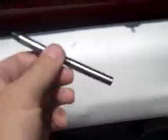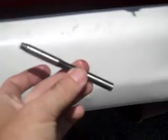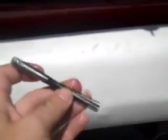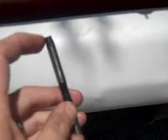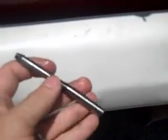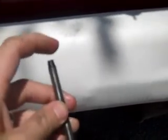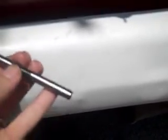Got my needle nose, cut the push rod out. I'm going to measure it now. I took it inside, found a measuring tape, and measured it — it is 95 millimeters long. I went on Mid-America Motorworks and looked at the three kinds they had, and their short one is supposed to be 100. You can see the flange around the edge there is all worn out. Even the strongest steel isn't too strong to be worn out. I'm going to go up to the import place and see if I can get another one. Since it's not too much worn off, it's probably about five millimeters, so I'll go with what they call the short push rod at 100 millimeters, and we'll see if that fixes the problem.